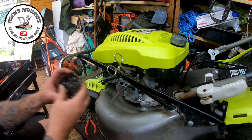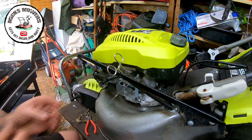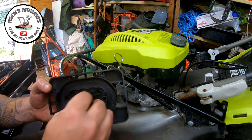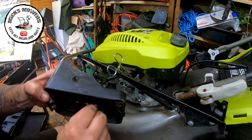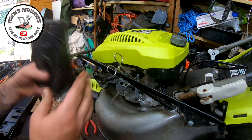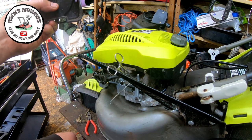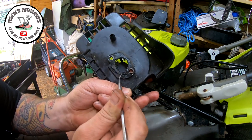That can have her back on. Carburetor on - that's good. That will now butt up tight. I've got two little tiny metal eyelets - I think that goes on the air intake box, they go in there. Little spacers. I'd like to do it best if I take it from the back. There's gasket glue on the back here as well, and you need it to run because that's where your primer goes. Let me find my dental pick. I wasn't expecting there'd be a bit of stuff on the back of there.